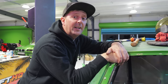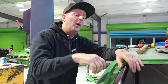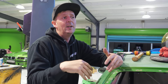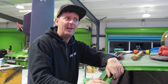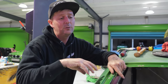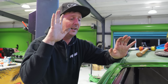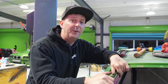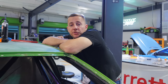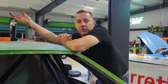We're pretty excited our Polish guy Adam is coming back in under two weeks — we miss him and we get to work on the F30. A couple people have been asking what's going on with the F30 and why we haven't got the finished video. So we had the diesel transmission from the 8HP70, which is out of the Jaguar or the 7-series diesel BMW in Europe — it was tuned for diesel. Diesels only rev to about 3,000-3,200 RPMs max, and we're trying to rev to 9,000. There's 6,000 RPMs worth of range it wasn't getting, because the transmission was tuned to shift at certain points and would kick into neutral or just shut down when we got into boost.